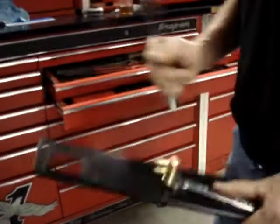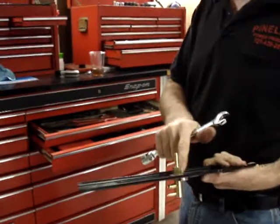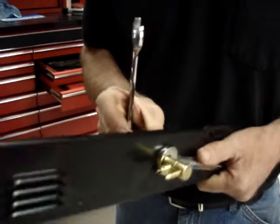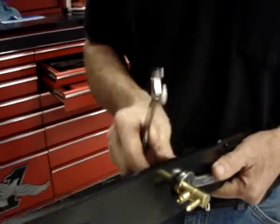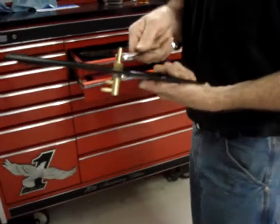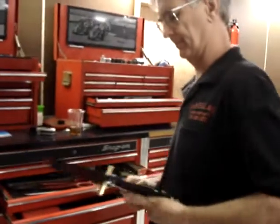And I don't like it. So I'm going to pull it apart, put fresh Teflon tape on it, and remove the washer. The reason is I just barely got a quarter of a turn on biting the threads good before it's already tight around this panel. So I'm going to disassemble it, remove the washer, and start again.